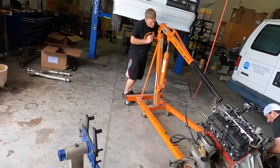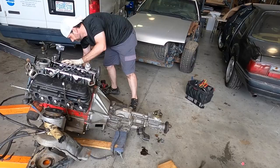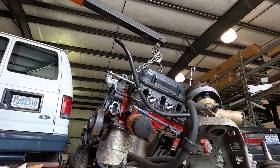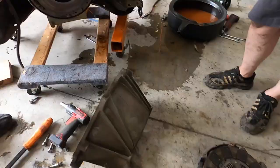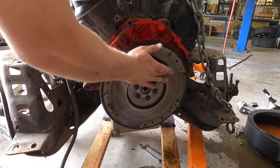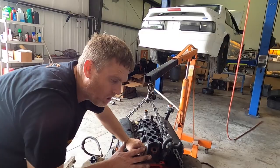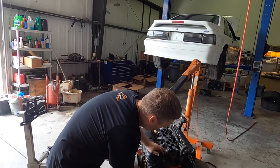They've been working quick here today guys — working on picking the engine up, getting the transmission off, getting it on the stand. I think this took like five videos on my channel, but we're doing it all in one go today. Clutch is out — might have had a little heat in this one. Just a little bit. See the hot spot guys — when we took this out the clutch cable was adjusted really tight. So basically what it was, it was adjusted so tight that the clutch was never fully disengaged, so it was always touching. It was like driving with a little bit of pressure on the clutch pedal at all times, causing slippage and overheating. That discolored spot right there — that's where the metal is actually hardened.